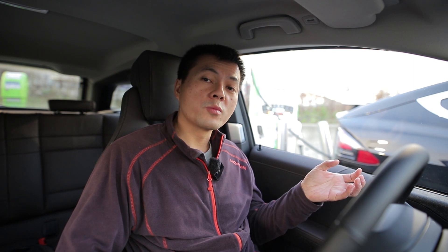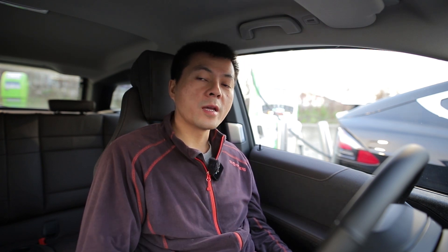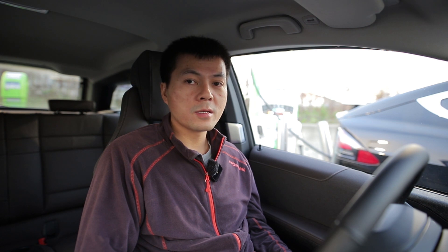Just as a comparison — in my Tesla Model S, when I arrive at the supercharger with 5% left and plug in, if I want to start the heater remotely, in the old days you couldn't do that below 20% state of charge, even if plugged in. But they fixed it with a software update. Now you can arrive at 1% at the supercharger and start preheating the car because it's smart enough to figure out you're plugged in at a high-power charger.